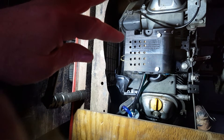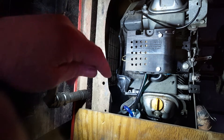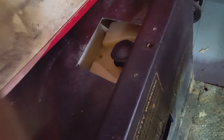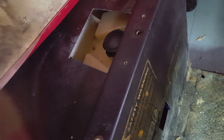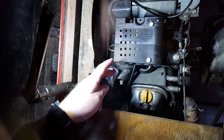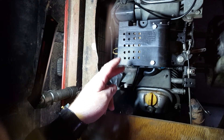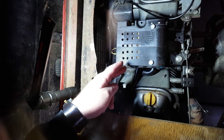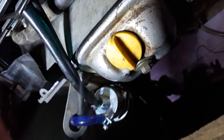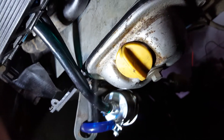So it would look like part of the problems we were having were that the fuel pump — even though it was a 2.5 to 4 PSI pump — was overriding the float and needle. I tried putting a tank up here because I was going to try drop-feeding it instead of pushing from the tank down below. But it looks as though this may well be the answer: when the pump fills the carb, it locks off, the back pressure is enough that it doesn't override the float, it drops back down to the tank, and that pulsing is gone. It's just a simple filter with a return.